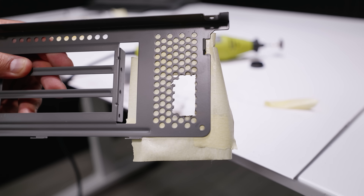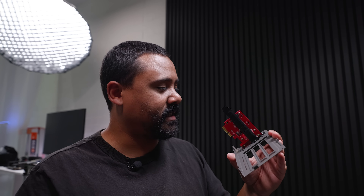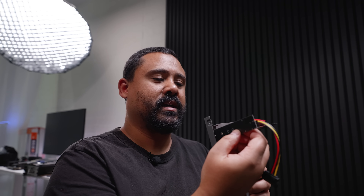That turned out all right - just get a file and clean it up, not bad at all. This is one of the most strange things I've ever done with modding. Basically I used a PCIe slot cover at the bottom to hold the card up, insulated it so it won't spark or kill the network card, then took off the rear bracket of the card and used some zip ties through some of the holes. Now the card's not going anywhere and when we connect it up we just push the PCIe slot connector onto the edge of the card.